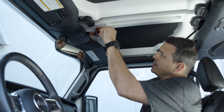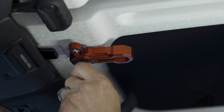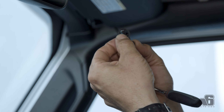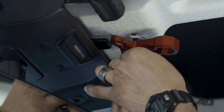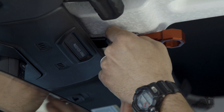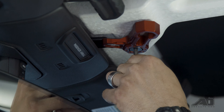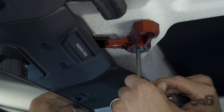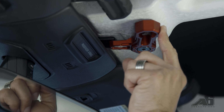So we are going to show you the difference between this and with the washer. Once you have one that is loose, take it off. Insert the washer onto the shouldered bolt and install that back in. When you tighten these up, make sure that the stop is actually inside of its little home there. You don't need to torque these like crazy — it's a really small bolt, this is composite. We have the torque specs in the instructions, but a nice snug is all you need. Now you can see how different this is — it's nice and snug, it's got tension, you've got a positive lock.